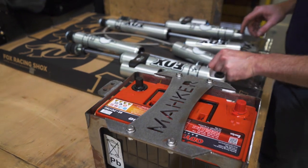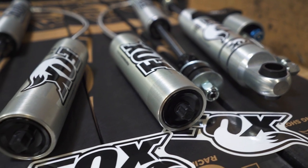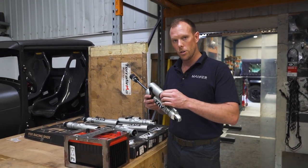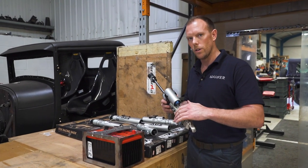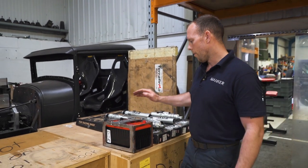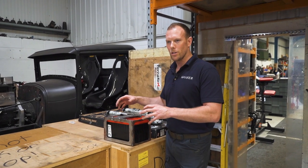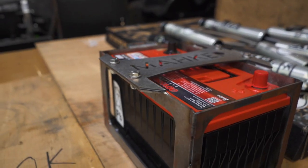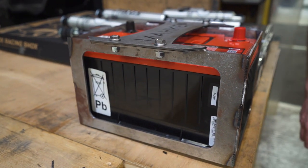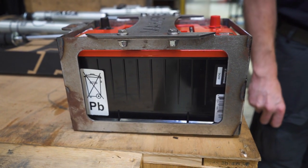There's a great delivery of lovely products this week. We've had these Fox shocks arrive from the USA — totally adjustable. If you're not quite happy with how your car is riding, you can actually turn the rebound up and down, going softer or harder depending on what you fancy doing with the car. We've also come up with this beautiful battery tray idea. We've always struggled with compacting Odyssey batteries into Defender seat boxes because seat boxes are brittle, soft aluminium, and we needed something strong and safe. So we can bolt it in at the base and clamp the battery in — safe and secure, keeping your power systems bolted tight.